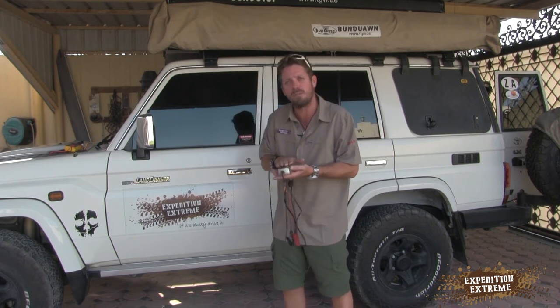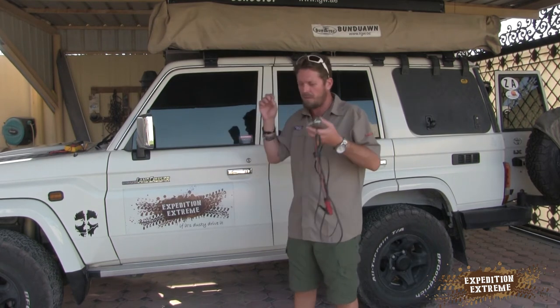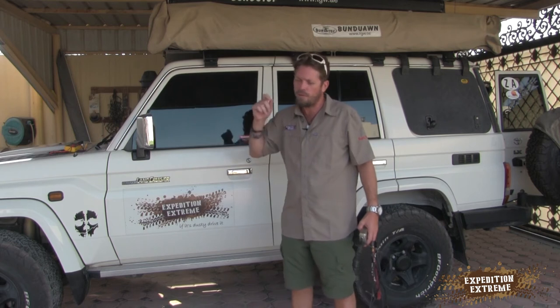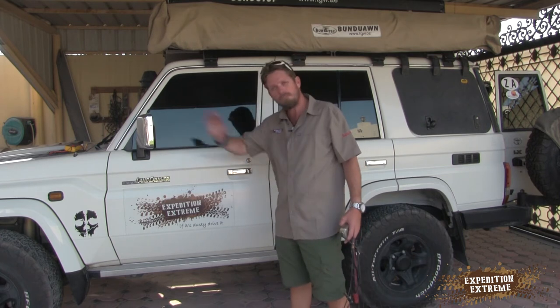Now, these charging systems do exactly the same. It will pump in quite heavily in the beginning, and then it will slow down and probably trickle charge at about 13.7 volts. If you do that for a long enough time, you can revive your batteries. And I do suggest, if you ever go below 10.8 volts, when you get home, stick your battery on charge overnight, for a day, for 2 days.